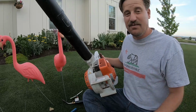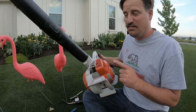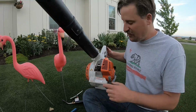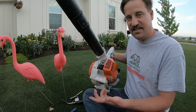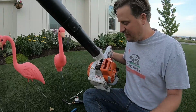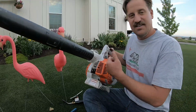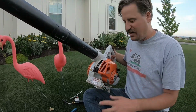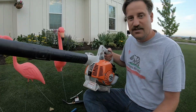Thank you for those people that told me how to fix this, because I pretty much had written this thing off and I was pretty ticked about it. So STIHL, if you're watching this video, that's a fail. You shouldn't build something like that that's just going to get clogged up that easy. So maybe this is in the owner's manual on how to fix, but who reads the owner's manual? You just throw those away when you get that and just start using it like you intended when you bought it. So don't throw the blower away, just fix it by cleaning the spark arrestor.